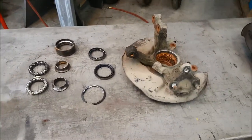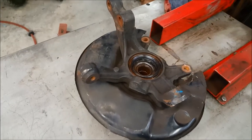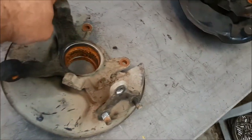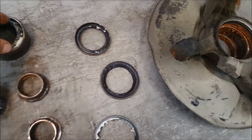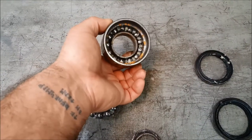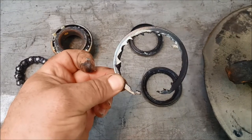Let me take you over to the knuckle joints and bits and pieces and show you what I bought. So first off, this is the old knuckle joint — and here's the drive flange so you can see how it all goes together. That's the new one, or should I say the replacement second-hand one from Toyota's Galore in South Auckland. Thanks, Brennan. And this is the one that came off the car. There is nothing wrong with this knuckle joint itself. The bearing sits in here — it's quite a large bearing. That's the outer race of the bearing. These are the actual bearings themselves — they sit in there like that. And that there is an inner race. The whole thing is replicated on that side as well. That then fits in there and is held in place with a very large circlip, normally.